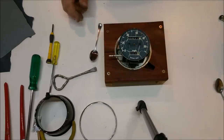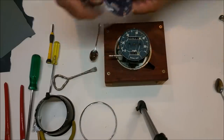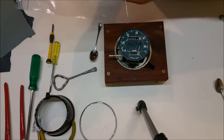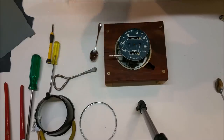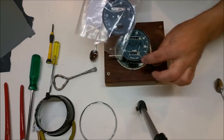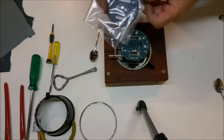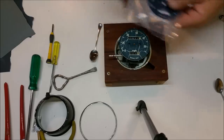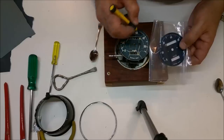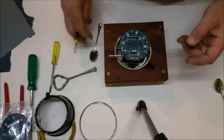The overlay we're using is typically just a sticker. We have to be careful how we apply this. This is from a great place, Classic Gauges, in the United Kingdom. Putting the tach one on was a flawless bit - really, really good. They're marked the same way, but every year Honda - which is the case with this gauge here - actually changed some of the configurations on the gauge. Some of them had an elongated sort of area on this digit, on both of these. Some of them are a different distance between here and here. You have to measure your gauges to make sure you get it right.